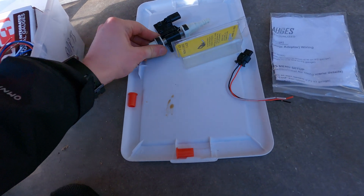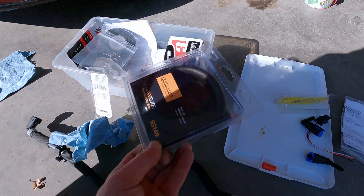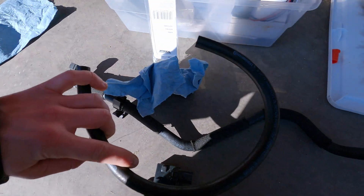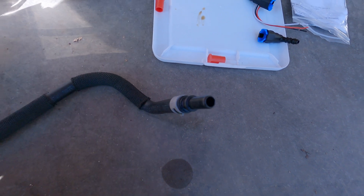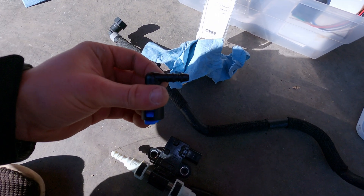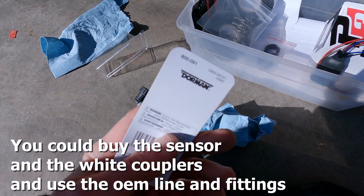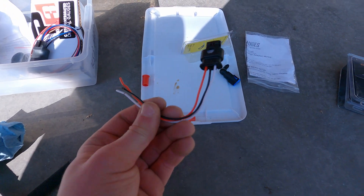All right, very nice. We have some Continental fuel line — it's roughly the same length as this guy here. We're going to have to steal this so that we can connect back to the intake manifold clip, and then we also have a fresh 90 for up by the coolant. So that'll be the same as that guy there. That's this part — Dorman 800-091. So we'll cut this up, get our line set up, and then we'll talk about how we are routing this.